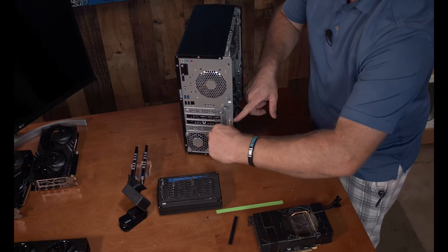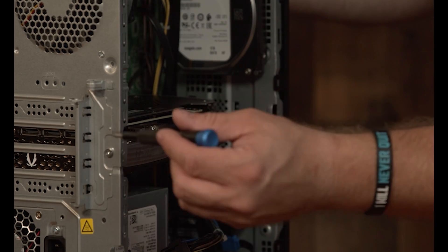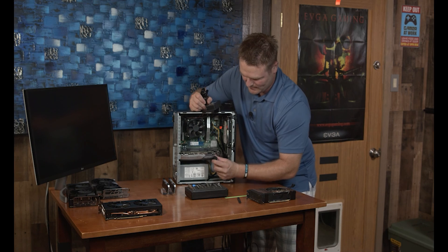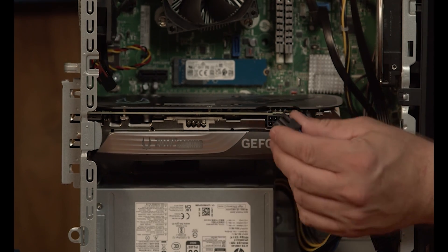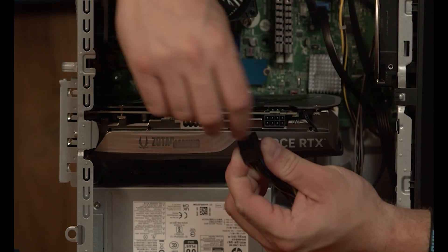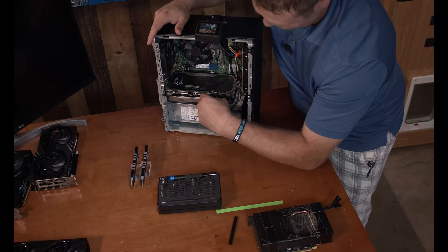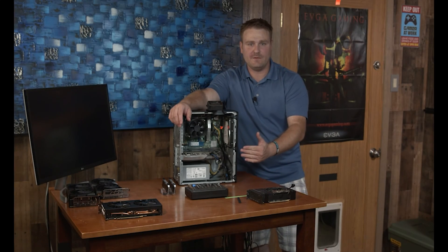Close your door, come back to the rear, and grab the T15 Torx head to send the retaining screw home. This is the screw that retains the graphics card — it's just the one T15 Torx right here, unlike most PCs. Now plug in the 6-plus-2 pin connector with the tab towards the top, towards the sky. It's a bit twisted, so get your wires combined and turned around. Roll the connector in until you feel it seat. Make sure it's fully seated.